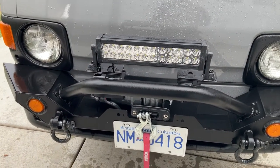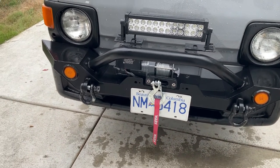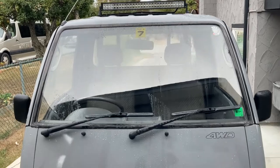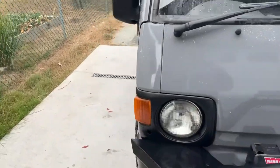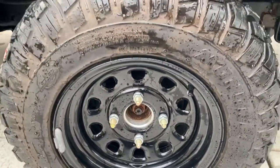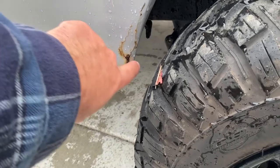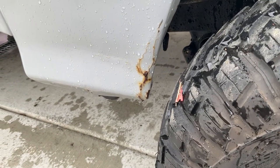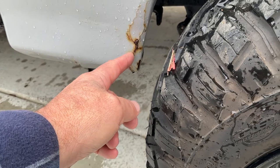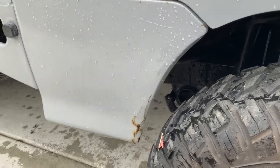When you take the bumper off that was exposed, so water would just go straight into the cab — so I made a cover that goes on there, and the air actually comes in from underneath below the YJ bumper. Blacked out the Subaru emblem, put a small light bar on that's hooked up with my high beams, and a small 2,000 pound winch — got this thing buried in the mud one time and that winch pulled it out. The light bar up top is hooked up to a separate switch and it is brilliantly bright. Tires are Mongrel 23 by 8 by 12 — great little tires. I am rubbing though — I beat this back with a hammer and I'm gonna have to trim it back, do a little welding, and repaint this whole rear quarter area.